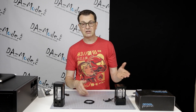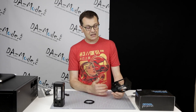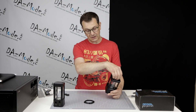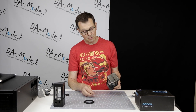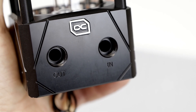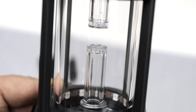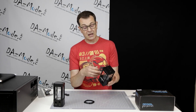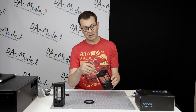That's not necessarily a disadvantage, but there is a difference in mounting between the two. For inlet and outlet options, you have inlet and outlet on the bottom, but if you want, you can keep the outlet on the bottom while the inlet can be one of three ports on the top — whichever one you want to use. Inside the reservoir you have anti-vortex fountain-effect tubes. I'm personally not a big fan of those because the holes inside the tube are pretty small, so they restrict your flow rate. But if you don't want to use them, you can disassemble the reservoir and take them out.